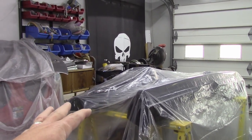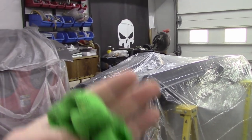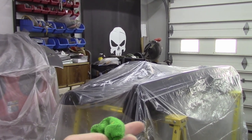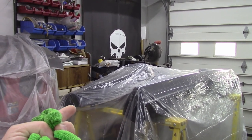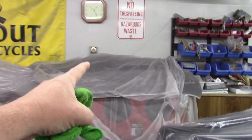Or would you scuff everything, reassemble the bumpers on the car, keep them loose, don't crank the bolts all the way down, let them hang out a little bit so that when I spray, I can get the base and clear up underneath and to those areas. The same goes with the valance.